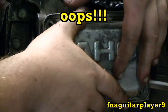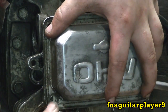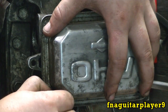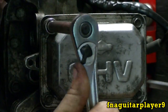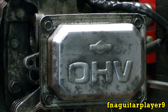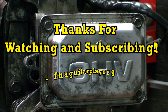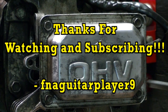After you get the valves adjusted, you're ready to put your valve cover back on. Make sure you put it on right, put your four bolts in, and once you get all your bolts tightened up you're ready to go. Now you usually have to replace the gasket on these — they seem to tear just about every time. Well guys, if you've got any questions or comments feel free to leave a comment below or send me a message and I'll get back to you as soon as I can. Thanks for watching — catch you on the next video.